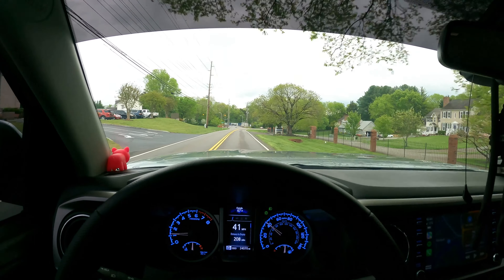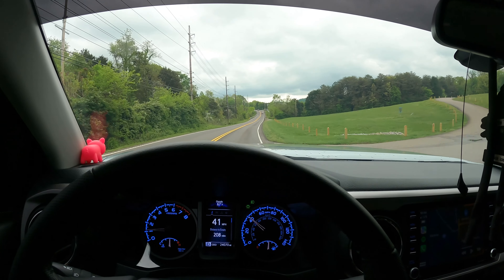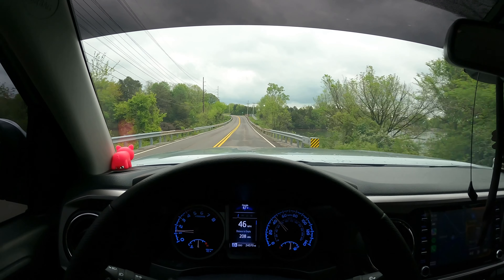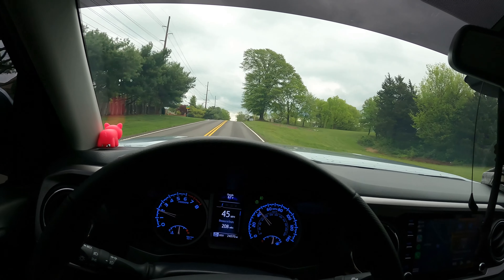If it doesn't settle level, you can adjust the coilovers. I'm not looking to do a squatted look at all. I've driven it in a bunch of different scenarios — back roads, on roads — and it drives very well. I also have the cold air intake and hotter coils from a Rip Performance supercharger on this truck, which really helps. I highly recommend doing those mods before you lift your Tacoma. Fox also realigned all my sensors so my active cruise control works, everything works as factory.